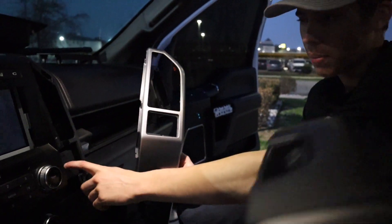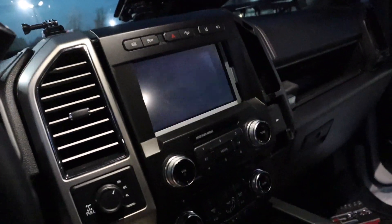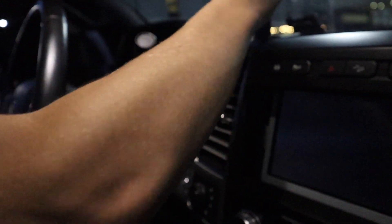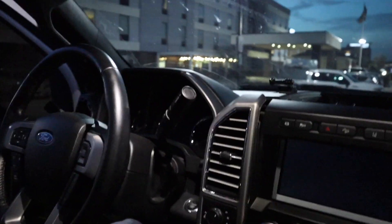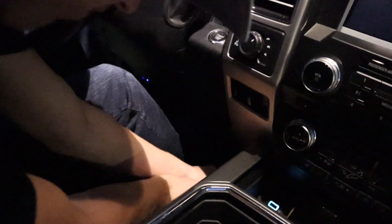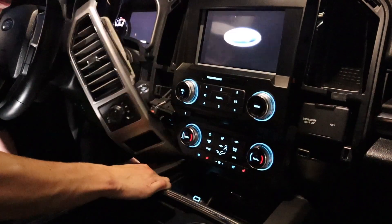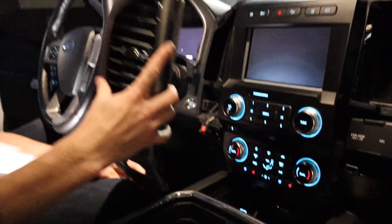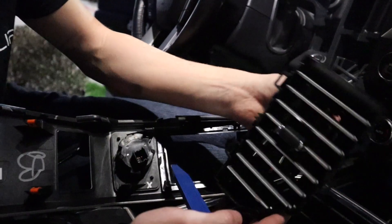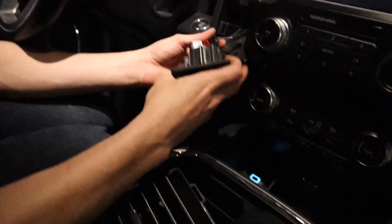I went ahead and took out the 12-volt and the AC power and just put it back in plugged in. So we're going to go on to this driver side piece now, then we're going to move over to the steering wheel piece. I'm just going to get a little help up here with the trim tool and get it started, popped off with my arms behind it, slowly pulled off. I'm going to pop off this side piece after we lean it back a little bit, go ahead and unclip these sensors, and that AC vent's going to be free — that's going to separate that whole piece. Just like the others, the polish piece will separate. I'm going to go ahead and plug back in the four-wheel drive connector and stick it up out of the way.